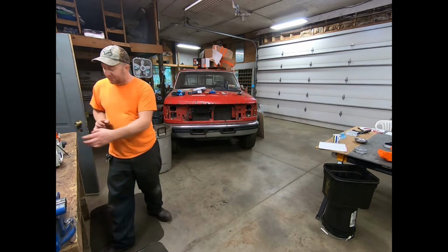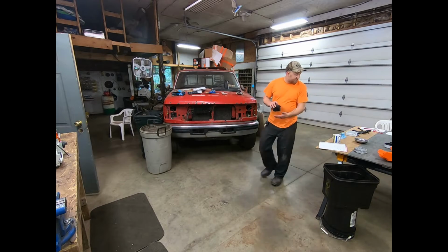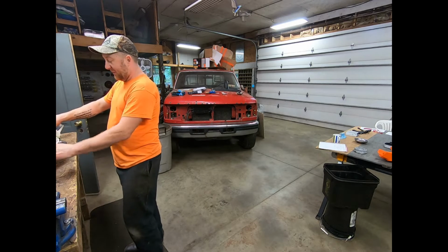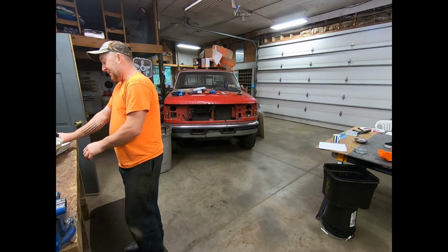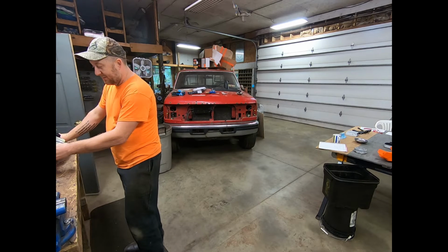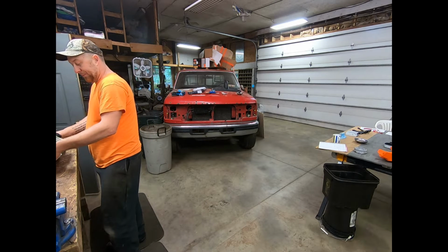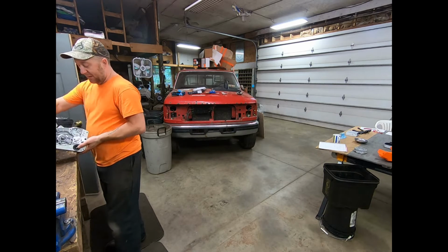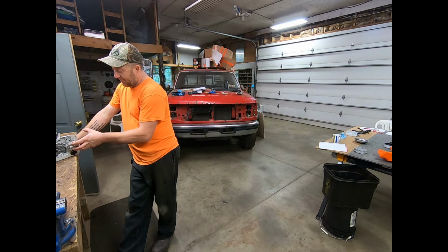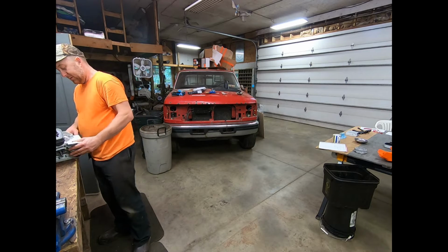So today I think I'm going to try to maybe put the muffler on, try to see what else I can get on while I wait for that keyway, because on this side pretty much the flywheel goes next and then the coil's got to get mounted. Probably can do the coil, maybe I can't, I don't know. I was figuring I'd wait until I put that flywheel on, but maybe I can put it on there, who knows. And then on this side, I'm waiting for the brake cover, the brake lever to come into this area right here, because I got to put that spring, which goes over that brake handle lever.